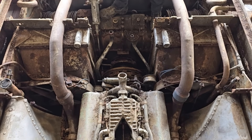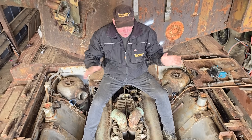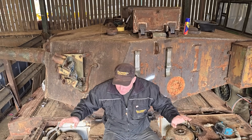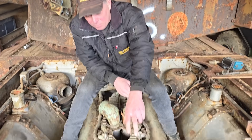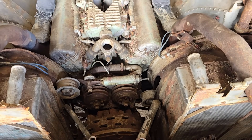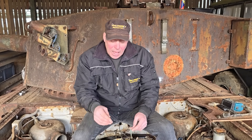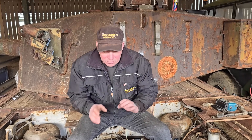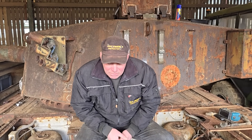The engine bay is in full view and the lads can see what condition the engine's in, and if there may be other issues moving forward. As you can see, it looks a lot different to when we first got it. All the engine decks are removed — they were an absolute pig. Took two days just to get them off with a lot of heating and hammering and swearing. Then down here to the clutch, we had to get a lot of the pipes off there, and the bolts at the bottom were an absolute pig as well. We had to rock it backwards and forwards very gently just to try and get everything to move. We were a bit worried that the engine might be completely seized, but the only way to do it was to move it a bit because we could not get at those bolts underneath. We rocked it and rocked it, and it's all moved. Hopefully the engine's still good, but at least we can get the bolts out so we can get the engine out — so that's all been removed.